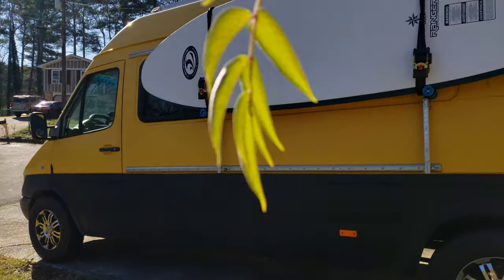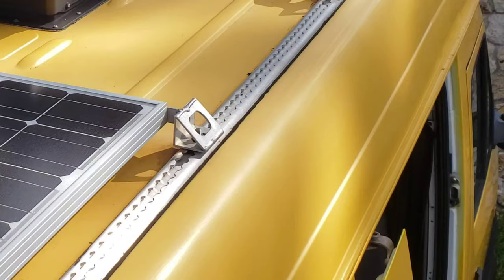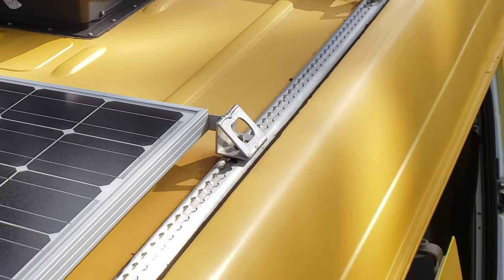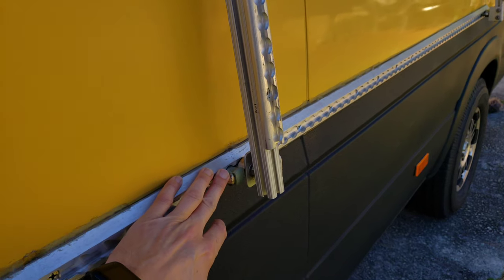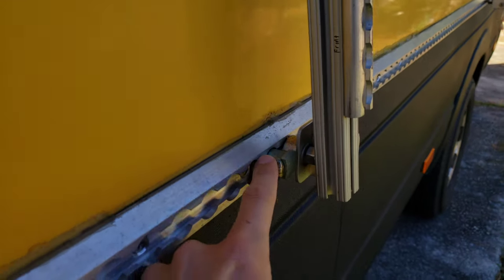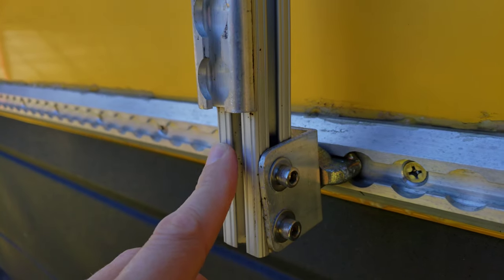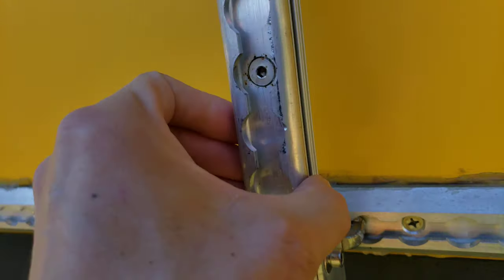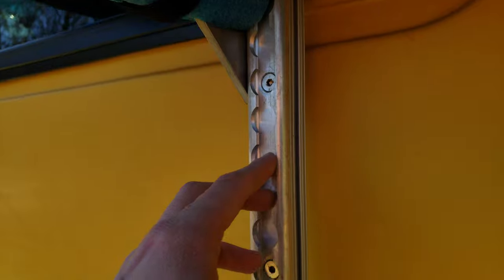Eight feet is the longest you can get it shipped and it's a lot less expensive to buy an eight foot length. For the roof rails I wanted one continuous piece. For the side rails I was okay with two pieces, because for the roof I didn't use any screws — only adhesive — and for the side I was using screws into the sheet metal, just to avoid any extra potential for leaks in the roof. From there I have these vertical crossbars attached, going between the bottom and the top rail. The crossbars are attached with quick releases, and I have an angle bracket attached to 8020 one-inch by one-inch aluminum extrusion T-slot. Then I have another piece of L-Track attached into that 8020 T-slot, which I can use for different purposes like putting quick release brackets in there to attach ratchet straps.